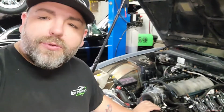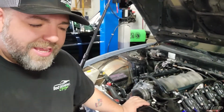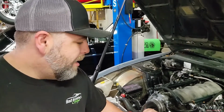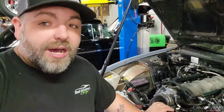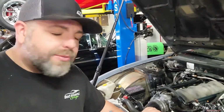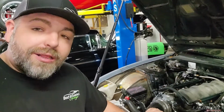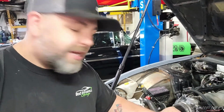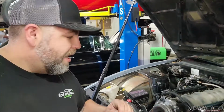It's very comparable to what you would see for a Brian Tooley Stage 3 turbo style cam. It's a very good cam. It's going to make a lot of torque, and it's going to be really good for this setup. He doesn't want to spin a whole bunch of RPM, so the RPM is going to stay low, but it'll make a lot of torque. So they also did, I believe, some new head gaskets and some other parts on here.